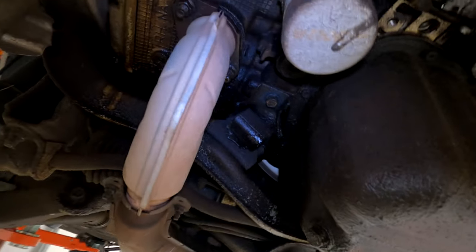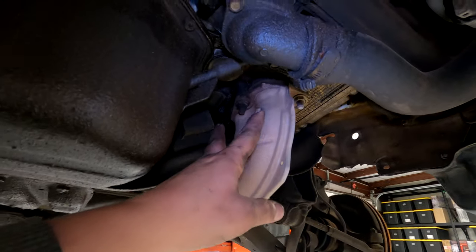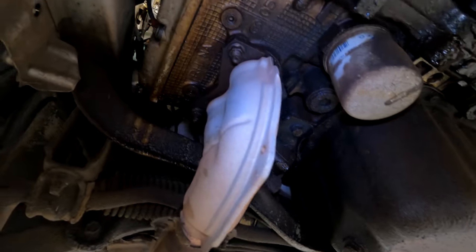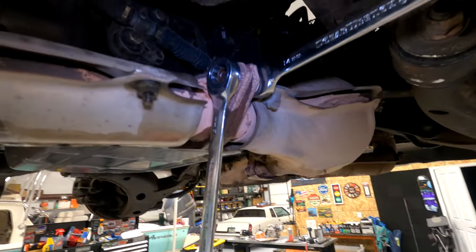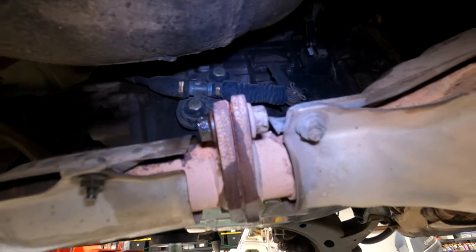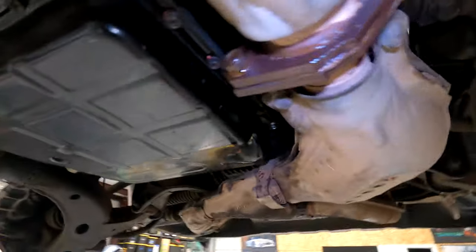To make my life less aggravating, we're just gonna take off the header. It's these bolts over here, these bolts over here, and then these bolts right here at the coupling. Use a 14 millimeter and remove the nuts that hold the header to each head. You need two 14 millimeter wrenches here because if you don't, one side will spin when you try to take the other side off.